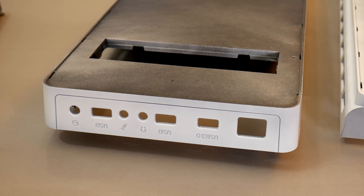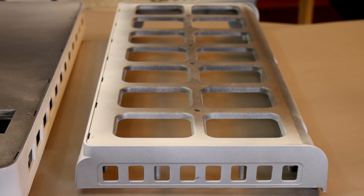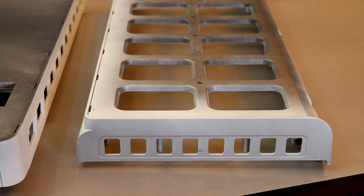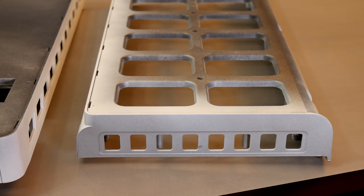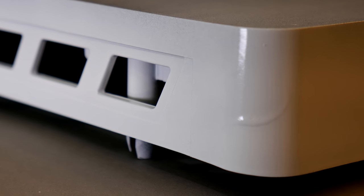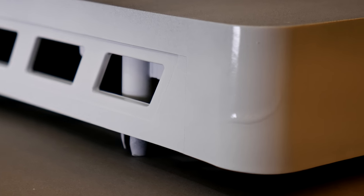It was originally black, but I used a coat of grey first and let it dry. Here you can see just one coat of white over the grey, and I don't cover everything in one coat. White tends to take longer than other colours to dry, up to 20 minutes depending on temperature and humidity. If you put down too much paint at once, your paint will run which is a pain to fix — you'll need to clean or sand it off and redo it.